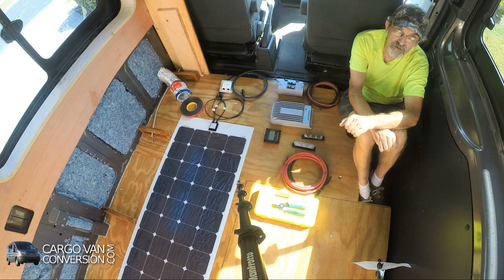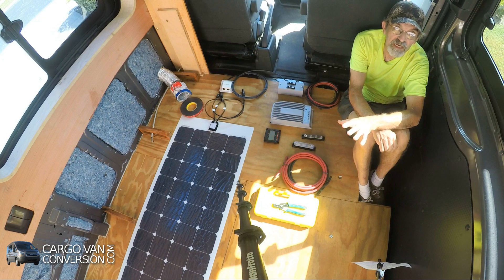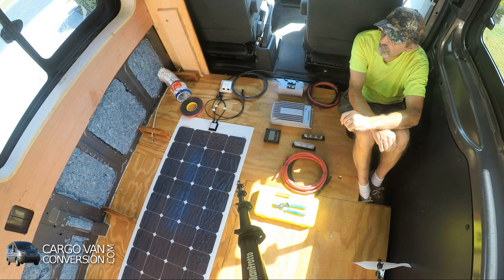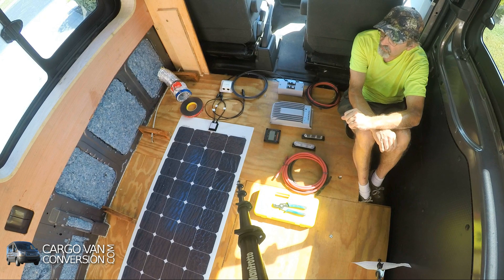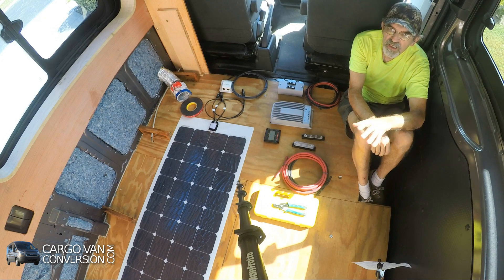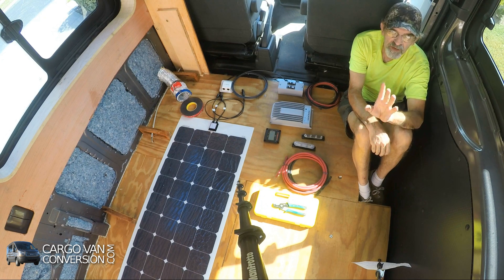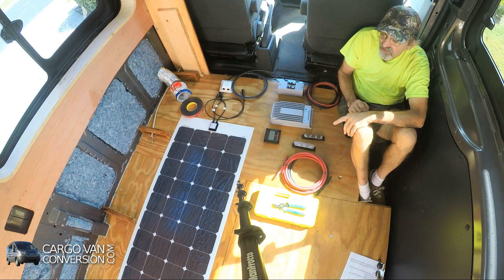The third part of the system are the batteries. I plan to use lithium batteries, but since they're first of all quite expensive and still a little bit iffy in usage, and I'm not using the van full time yet, I want to wait as long as possible before buying those lithium batteries. In the meantime I'll be buying two regular six-volt golf batteries for a basic 12-volt system. The most use I'll probably get out of it is by using the roof vent, which hasn't been connected yet.